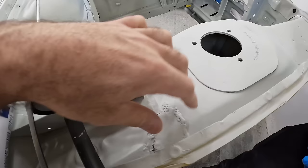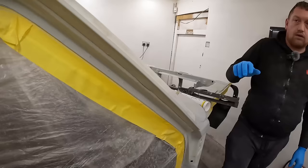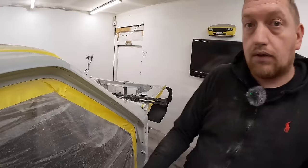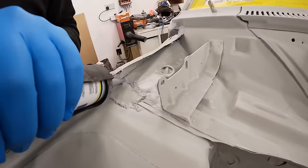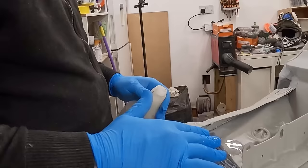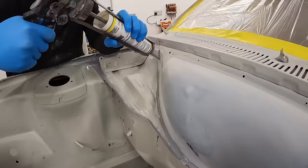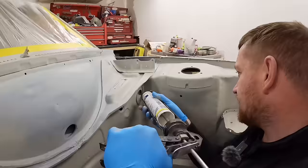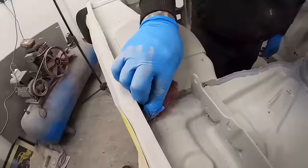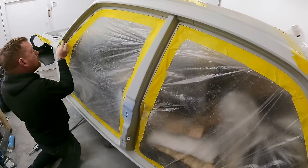Originally they have sealer all along here, around the heater bubble, and around here as well. We want to chuck a bit in areas like this too, just to give it a bit more protection, and the same bit on the back down there. With the sealer opened and loaded into the gun, Rob started spreading it over the seams. He tried to find a balance between making it look similar to how these cars were when they came out of the factory, but also making it look nice and tidy. Underneath the rain gutters, Rob applied the sealer, but then wiped it all away so that it was only left inside the seam itself.